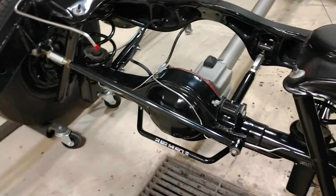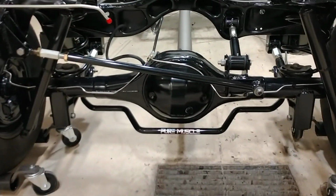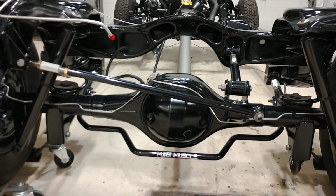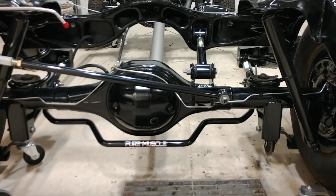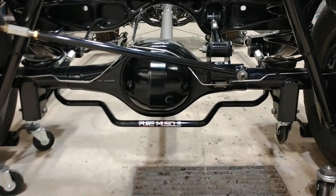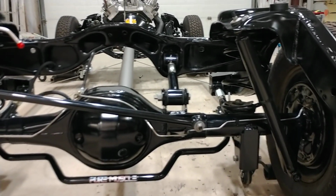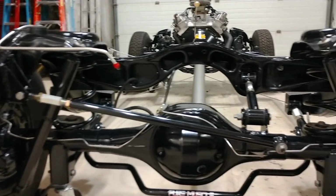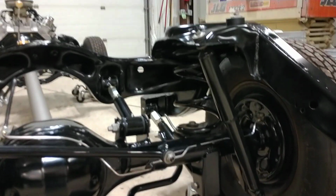Like I said, everything was tore apart. I put an adjustable suspension system on. Works just like the factory, except you can adjust the in and out tilt of the pinion. Basically give it a 4-wheel alignment. It's got a sway bar on the back, which this car never had. Put new springs on from Eaton's. These are 427 springs, or station wagon. They're just extra load. They're built a little bit different on the coil.